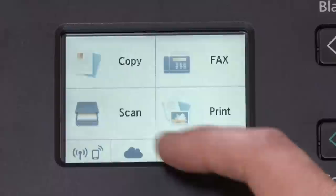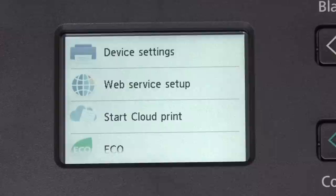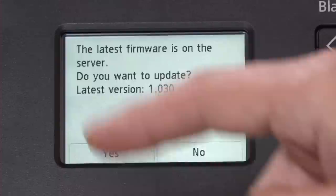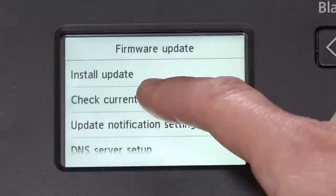I want to show you two more things in the settings menu. The first is important: this printer connects to the internet, and firmware upgrades are really important in this IoT world. It doesn't look like this one installs them automatically — you have to go seek them out. In settings, under device settings, scrolling to the bottom there is a firmware update option. It turns out there is an update waiting for me, so I'd add it to your to-do list to check every once in a while. If there is a security issue, your printer might introduce a vulnerability onto your network that you don't want. I'll install this firmware update tonight just to make sure I'm up to date. Unfortunately, when you check the current version it doesn't tell you that you're not on the current version.